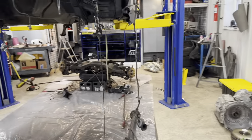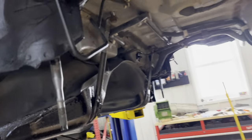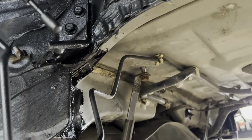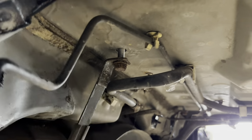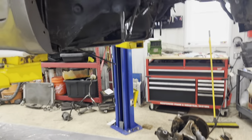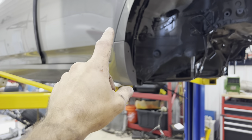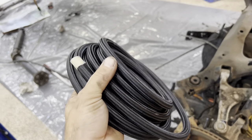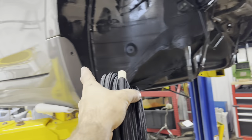The easiest way is to drop the tank a little bit. It can be sketchy though, because when the subframe is in it actually blocks the clearance for those bolts — not completely, but enough where you're going to need a swivel. And if you send it out too far it is not fun trying to get that bolt threaded back in when you've got coverage blocking it from straight on. That should give me enough clearance to run this 8AN. On this particular case I'm actually going to be running it from the driver's side, which is not the fuel pump side. The reason why is we have a radium surge tank coming, and it feeds from the driver's side, so I've got to go from the driver's side over to the passenger side and then down the chassis of the car.